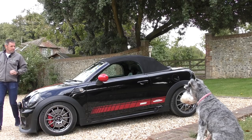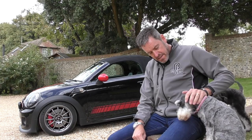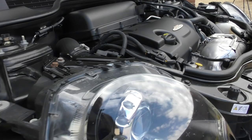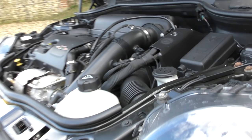Back at the barn and I am just so chuffed with the way this car's turned out. I had some thoughts about what I wanted it to look like when I started the process, and I'm absolutely chuffed to bits. What do you reckon, Petrol Pooch - oh you're in on the action as well! Shall we tell everybody how much everything cost? Let's start with the very first thing we did, which was Performance Pack 2. I've written everything down so I don't forget. The Performance Pack 2 is a Lowen package that included a Stage 2 remap, taking my power up to 270 brake horsepower and 395 Newton metres, and an Akrapovic 100-cell downpipe.